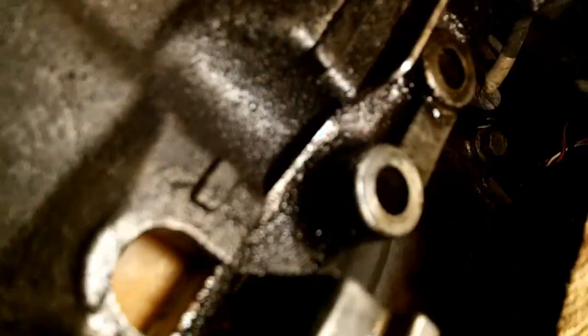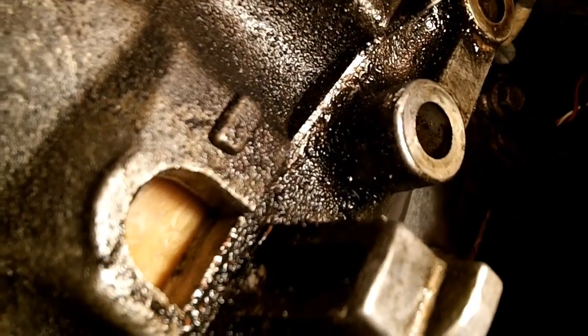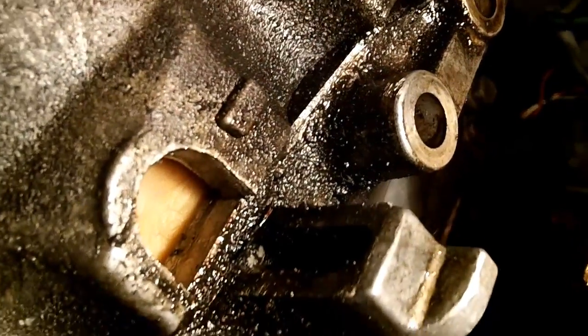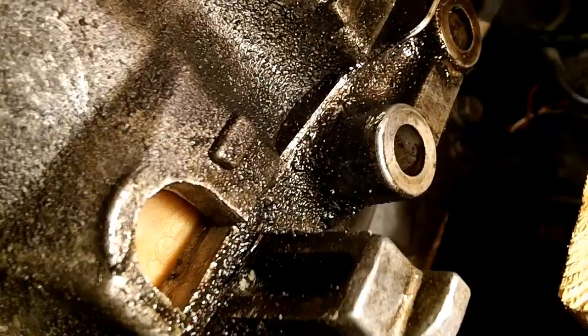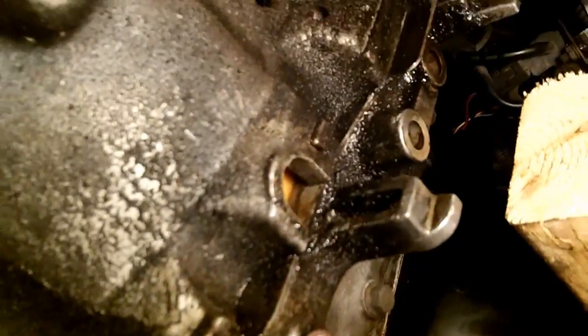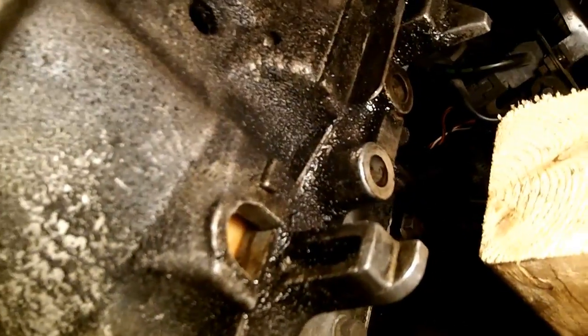That thing works amazing. Alright, now we are underneath the transmission, and there are these little black plugs, which I mentioned earlier. I didn't really think much of it. They're just kind of like seal plugs, and if you look directly under it, you'll notice that there's part of the wheel there. My guess is I'm going to have to rotate the wheel until something presents itself, and then stick a socket or something up in there to remove some bolts. It's on the jack on this side, so if it does actually slide off, which it's not because there's an axle there, it'll end up sliding right down my face, which is one of my nightmares. So just don't put yourself in this position and do this step first.